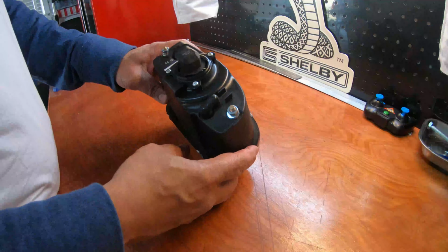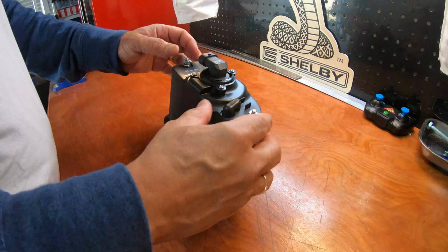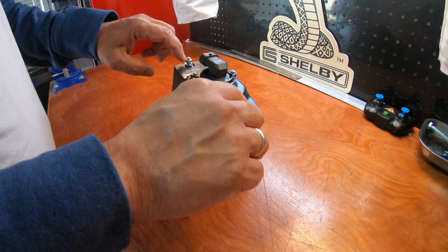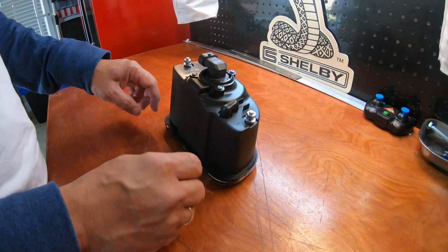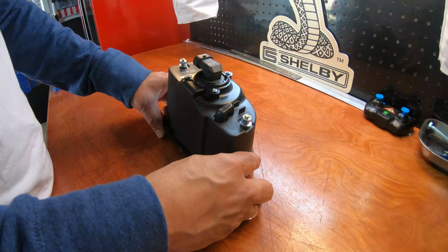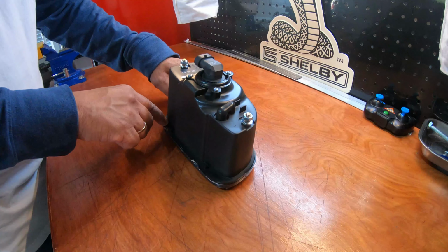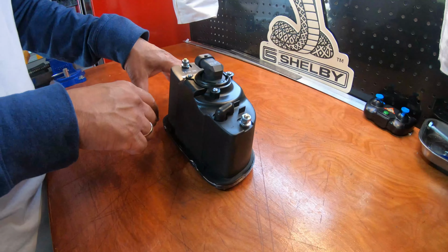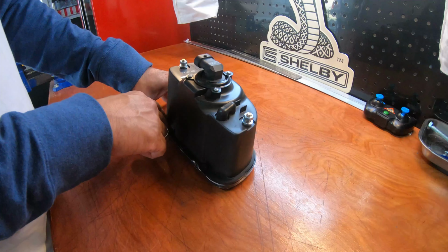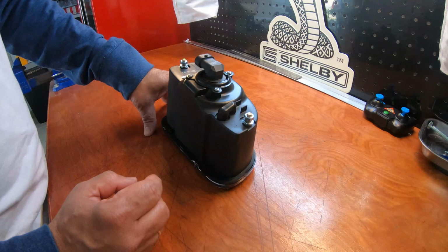When this fog lamp slides into the bumper, there's a sleeve on the OEM bumper that is meant for the fog lights. There's a sleeve that comes along the side of this thing, or a bucket, and it has holes for these to tighten up. Since I don't have that, and I'm gonna cut a hole in the bumper, it's gonna leave a little bit of a lip here on the bumper, so when this slides in, there's something to hold on. I'm gonna fabricate an aluminum bracket that goes down this way, so when you tighten up on this nut, it presses up against that little piece of the bumper that remains after I cut it out, and holds it snugly in place. Alternatively, I could just epoxy this into place, and that might work too.